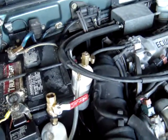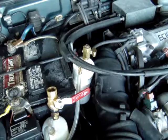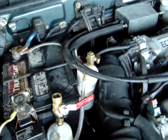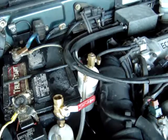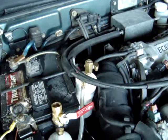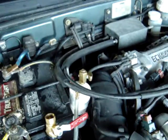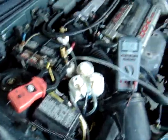The second little reservoir behind that is what I created to solve a small problem I was having. After the cells heated up and the vehicle was parked, the system shut down and the heat from the cells would actually draw the water out of the bubbler. The little cylinder back there acts as a reservoir so that when the water is pushed out of the bubbler, it's pushed into this small reservoir where it's collected and can't be drawn completely back into the cells, so that the bubbler never gets emptied, which would be dangerous.